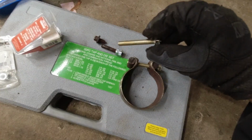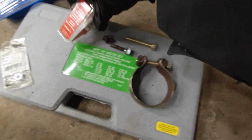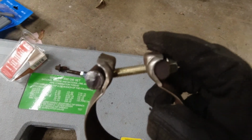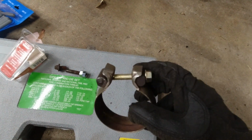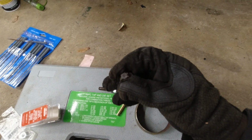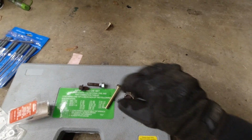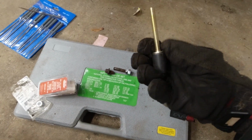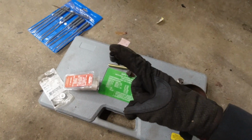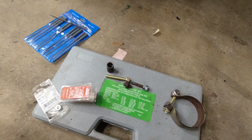So this is one of our new bolts from the auto parts store. M8 by 1.25 by 60. It's the same length here. So I reassembled this, and I'll slot that over the piece of exhaust for later when we put it back on. Instead of being an E-Torx, it'll be the hex head. And what's nice is that these are also 13, which will match the exhaust flange that goes to the exhaust headers up at the front.